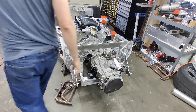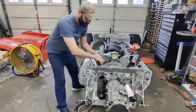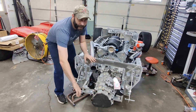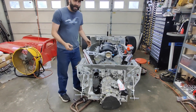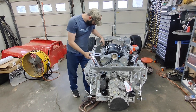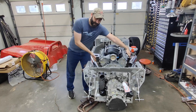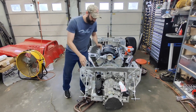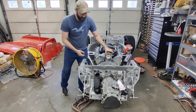On the driver's side, we're going to continue again at the same body line angle — come straight back here, down, and out. For the cold side setup, we've got a dual inlet intercooler coming, so the cold side will mirror these images. You will have the inlets right here with a single outlet right in the middle. It'll sit right up in this section, so the cold will come in here, come out here, right into the manifold.